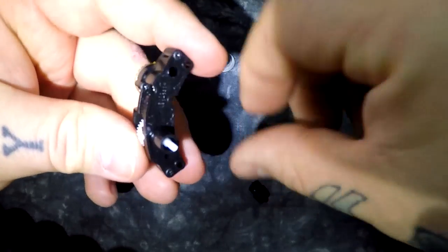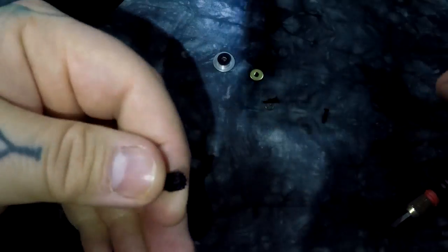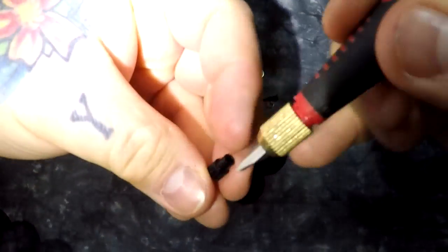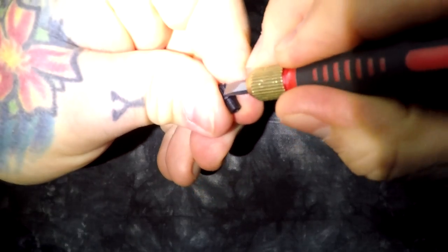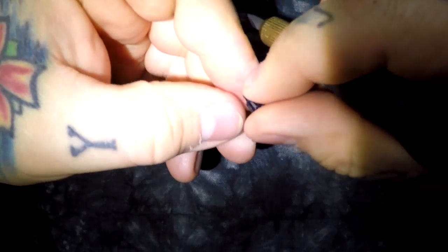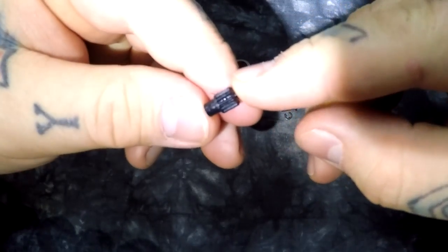What happens? You see this? This is on the shaft right here. The entire autofocus of this lens hinges off of this little gear right here. You want to see how tough this little gear is? Let me move my GoPro a little bit. Let's see how tough this micromotor gear is. Look at that — it's really soft. I'm not even pressing that hard. I've totally peened it over. I actually scraped off half the gear with just a little bit of pressure. Look at the shaved plastic coming off of that.